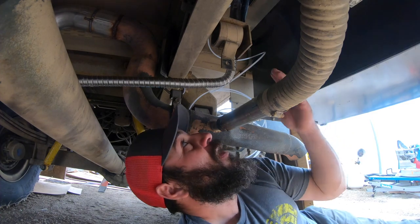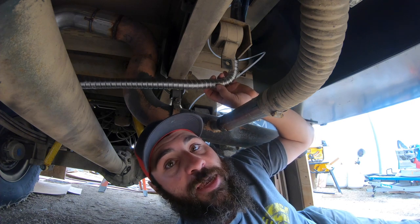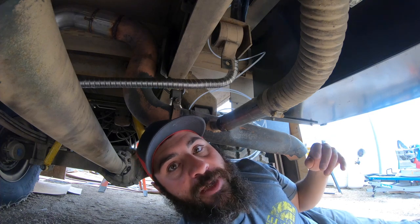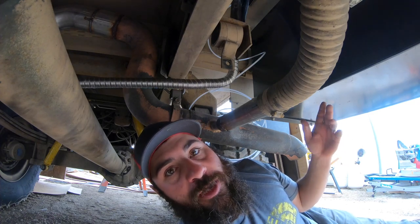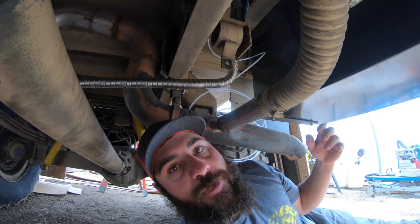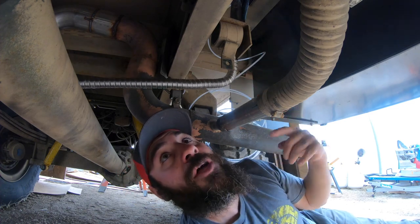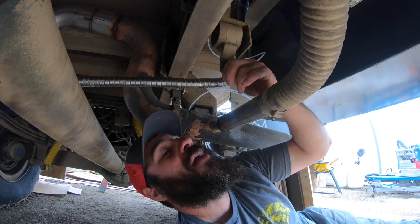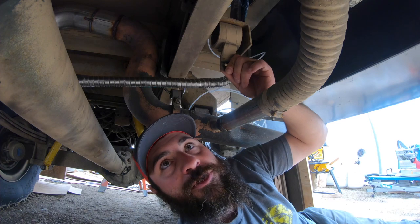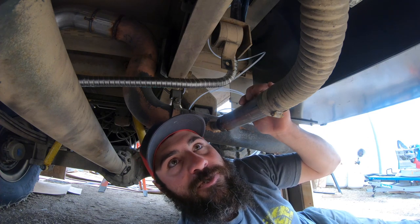From under the truck, this is my exhaust line right here, and I'm going to be running my airline — my air intake — to the outside of the truck. That way I can easily cap it if I'm driving on really muddy terrain and I don't have the heater running. I'd like to be able to cap it so I don't get dirt and grit into it. I think I'm going to run the exhaust back toward under the truck and utilize this exhaust hanger right here. The reason I'm okay running it under the truck is because I've already run the Binar heater.